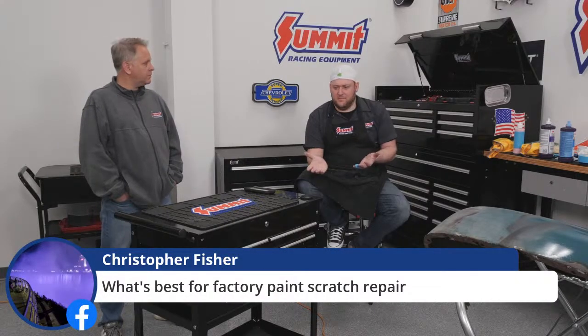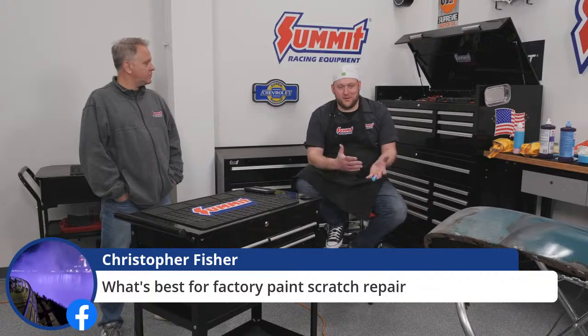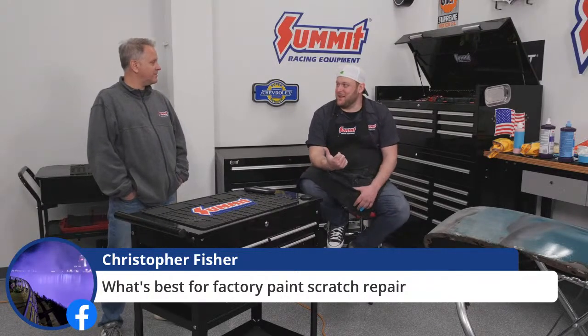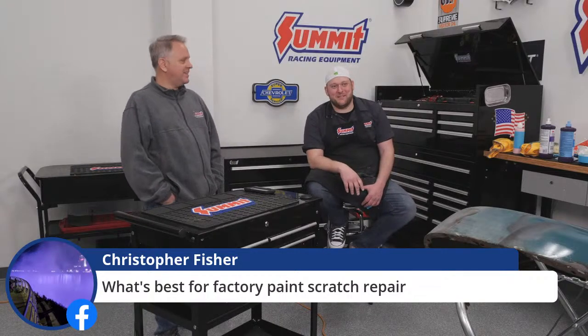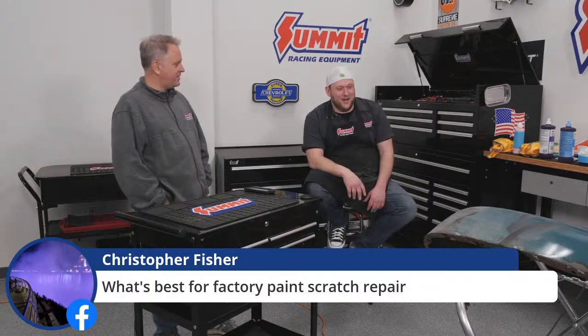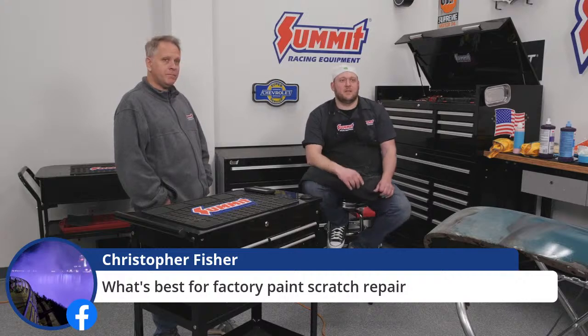I guess the third biggest mistake, if you're buffing, you're going to go through. I have a 78 Volare station wagon out there that I burn through all the time, but I'm planning on repainting it anyways. So I burn through it when I'm buffing it to shine it up. But you're going to burn through it somewhere on an edge, and just always go away from the edges.